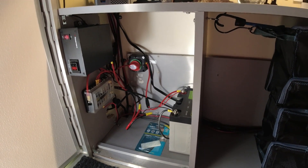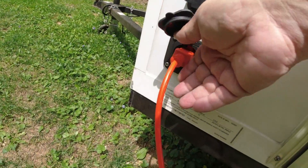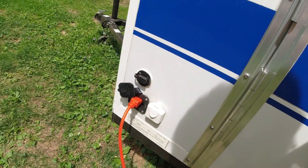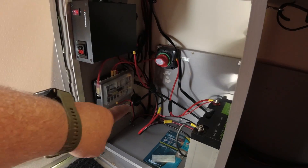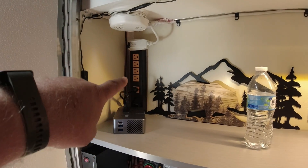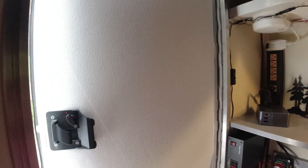The system that comes with the camper is a plug on the outside — a three-prong plug — that brings your 120-volt power from the power pole at your campsite into your camper. Once it comes inside, it goes into a power strip. If you've got just the Cool Camp, that's all you'll have. If you've got the Range Runner like I do, you'll have another cord that runs to the back with another power strip there.